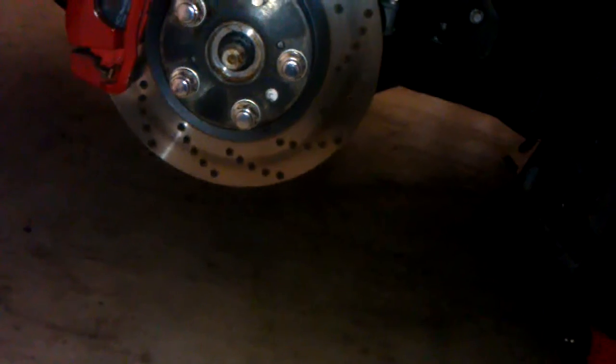Just a warning about what I said previously about using a jack to support the rotor — it was a great idea and it worked great, however, I just drove around and there was just an incredible loud squeal that would not stop. I spent half an hour figuring out what happened. This metal back shield ended up folding up against the rotor. So, using the jack is convenient, but it's not recommended.